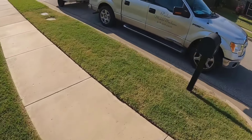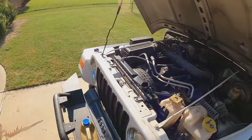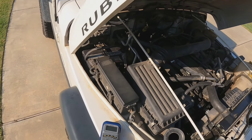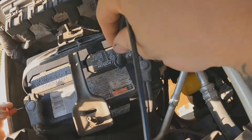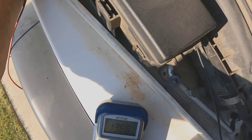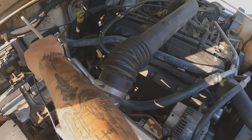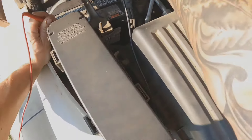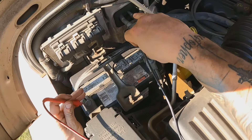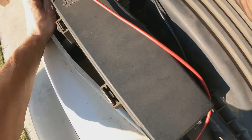He had asked me to check the starter because of the slow starting. The cold cranking amps on a battery are important — they're the cranking amps for the vehicle. If you have a weak battery or one that's suspect of being weak or old, a slow start would result. I can tell this battery is older than heck. Let's see what our volts are — we've got 13 volts, holding steady at 13. A good alternator would push about 14 volts with the engine running. With the engine off, we've got 12 volts on the battery — that's good, it's almost at 13.